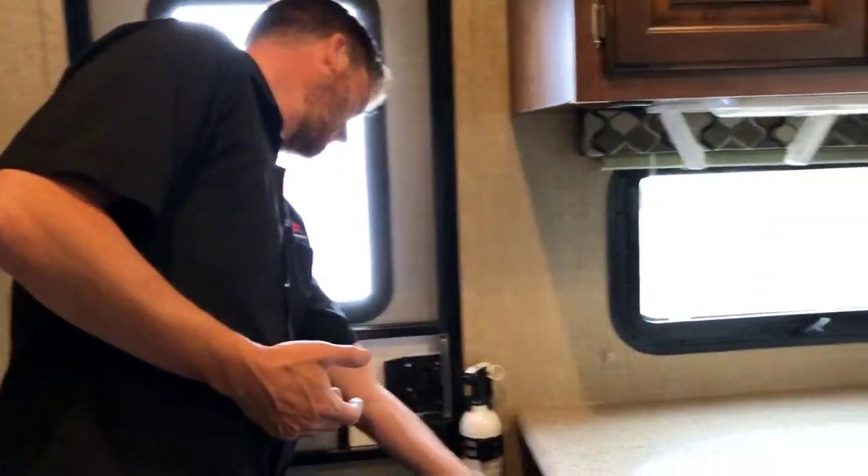For now I'll shut that inverter off. When you're not using the inverter, best to leave it in the off position as it is a constant power drop on the battery.